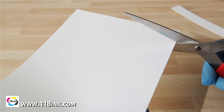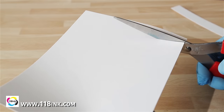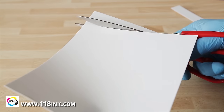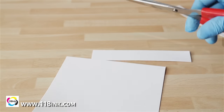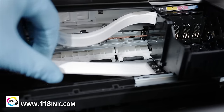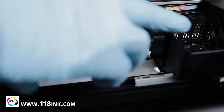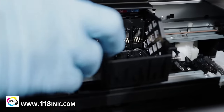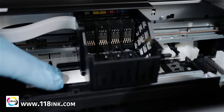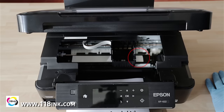While you wait, carefully cut two 20mm strips from the provided blotting paper. Some printers may need slightly different sizes, so cut as appropriate to your machine. Take both strips of blotting paper together and slide underneath the printheads. You can pull the carriage across to help make this easier. Make sure that the blotting paper has gone all the way under and is visible on the far side of the carriage.